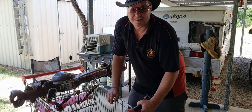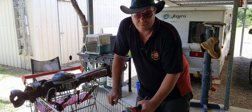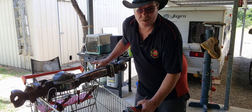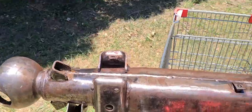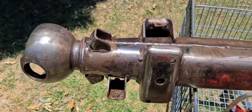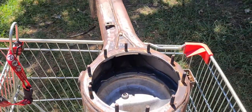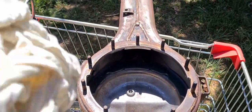Another bit of a tip: don't sand the welds all the way down. I've seen that before where people have gone for that nice seamless look — don't do that. It's the end of the week already, I'm back. So last week we got this all stripped down, sanded, ground, wire wheeled. All I'm doing now is degreasing it — super cheap heavy-duty degreaser.